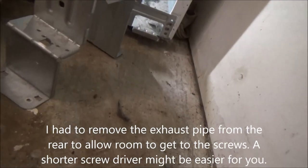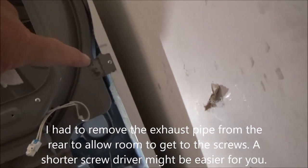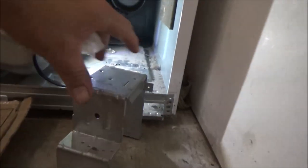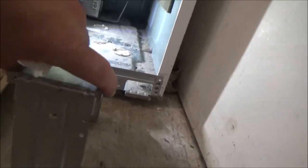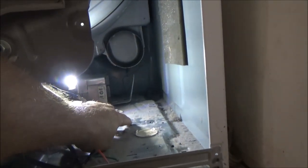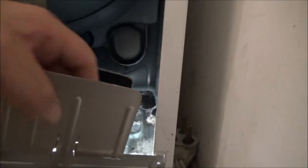After a nice long battle with this thing - it had two screws in the back. The way this thing is built, they mean for you to take these screws out and take the whole drum out, and by the time you do that there's nothing left - you just got a shell. You've got two screws here, two screws in the back, and one screw in the front that holds the element in. The element sits in that hole back there and it blows or sucks air through there, then it comes out through here - this is the lint filter. These little pieces down here are sharp as hell so watch out for them. There was one wire on this thing that I couldn't get loose, so let's pull it out and get the wire loose.